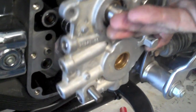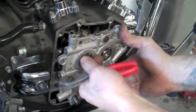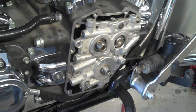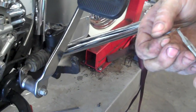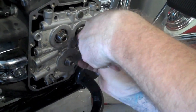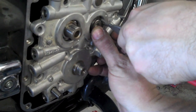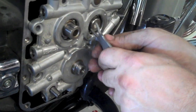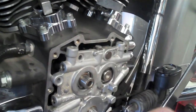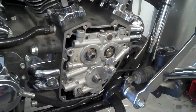It's not a balanced motor, but it still needs an o-ring to keep the pressures. Turn these cams just a little bit and rock around the lifters — that sits right on in. Here's that snap ring that came with the kit; I'm going to put that on the front cam. That's nice and seated. Away from my pinion — I need to turn my pinion so that this square is headed towards it, to make these cams fit right.